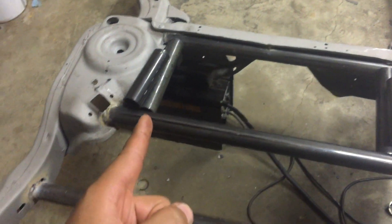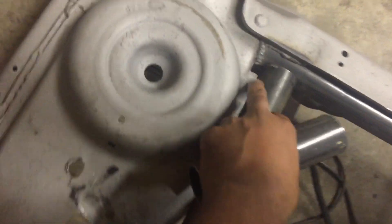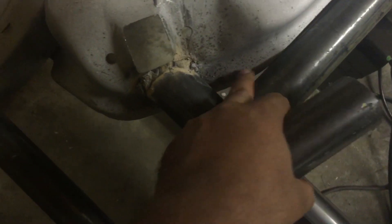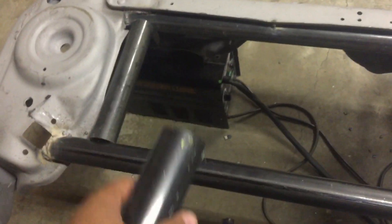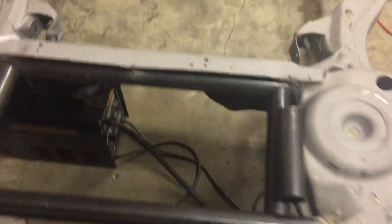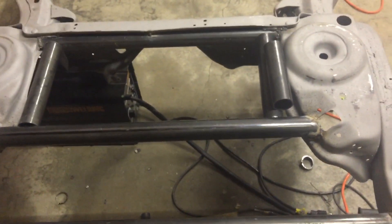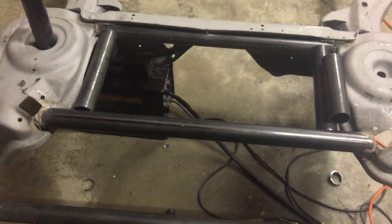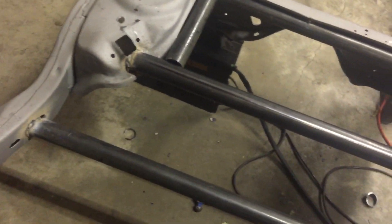Yeah, that's the idea — I think I'm gonna go straight down, like I said, just tie these edges in, get all the welds, fill up that hole, go along there. Then I can put a piece of metal in, or fill it in, or leave it open — I don't know. Only reason why I really don't want to do the diamond or X is I really don't feel like doing extra cutting at an angle at a table saw or something. Using just the saw-all and cut-off wheel makes it hard to get that angle right on both sides, and it's time-consuming trying to grind them back even.